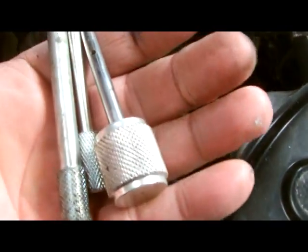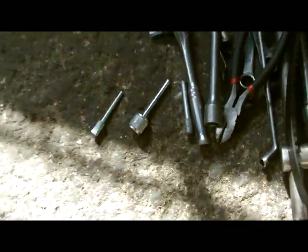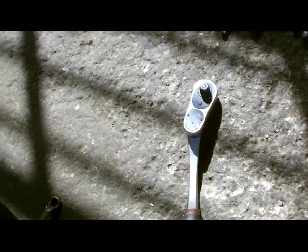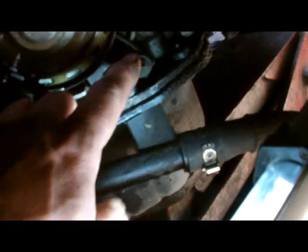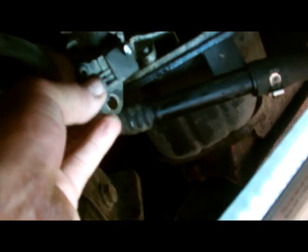Okay, we remove the 3 locking pins. Next step now, we need an 18mm socket and bar. And we'll crank the engine over 6 times. So, you need an 18mm socket, and we'll replace the wee plastic holder here. Don't forget to take that up, and then we'll put in the crank sensor as well. It's on there. We'll tighten that up.